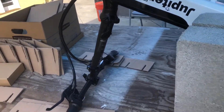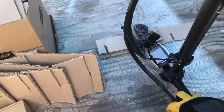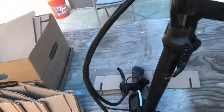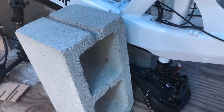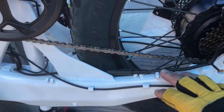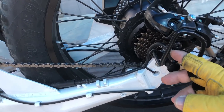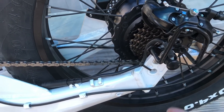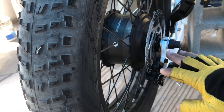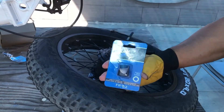I've got the bike propped up upside down on my table with cardboard underneath the handlebars so it's not sitting on the gear shifter. I loosened the hex wrench bolt to rotate the computer so it doesn't scratch, and put cinder blocks under the seat to keep the bike from falling when I put torque on the bolts. You need to snip off the zip ties and undo things so you can start taking this apart — make sure you keep track of the order of bolts and washers. We'll start on the brake side since it's easier without the wire.